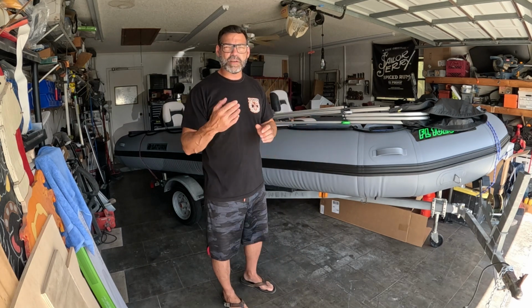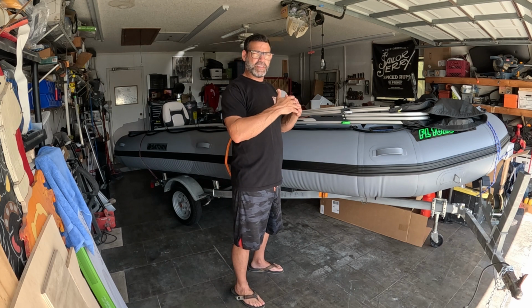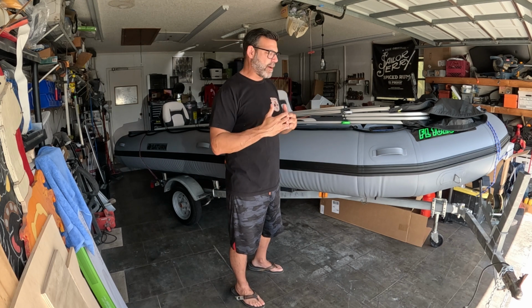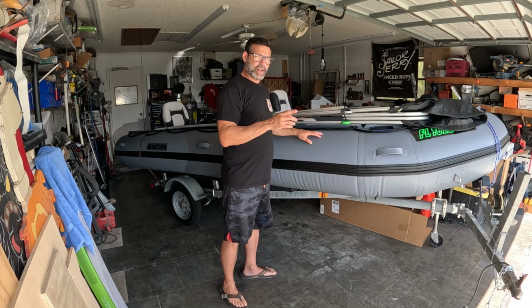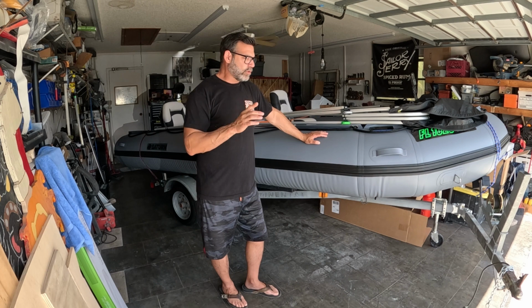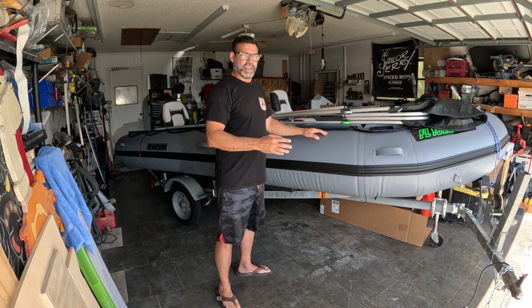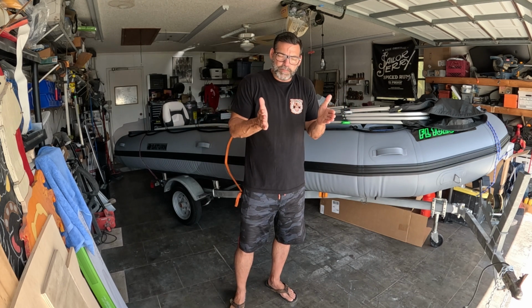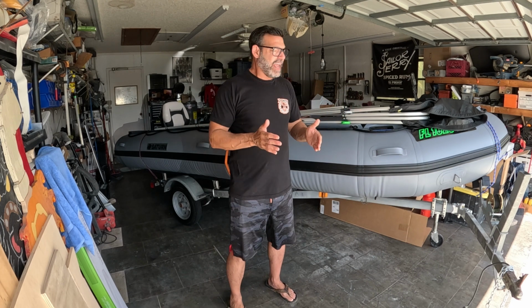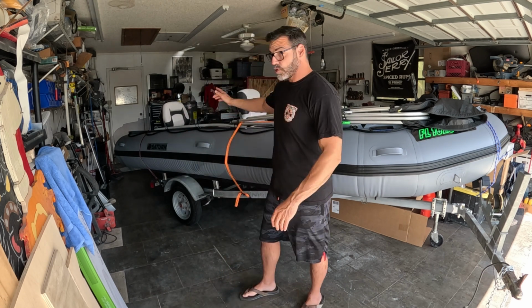Quick video about something I got a question on. Buckling and popping on the floor on these in hard wake and heavy chop. It is absolutely critical that you follow the manufacturer's recommended air pressure in order to avoid this problem. If you have your boat underinflated, you're not giving enough pressure and support to those struts that are holding your floor firm and rigid, and you're causing undue stress on all the joints as well as your transom.